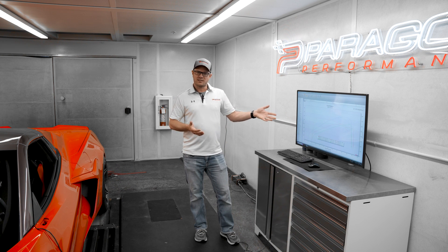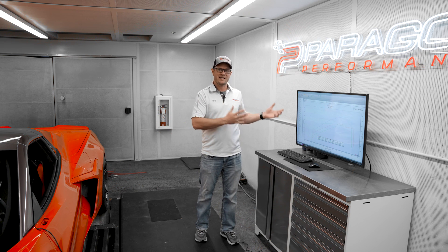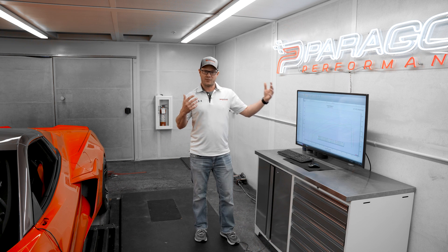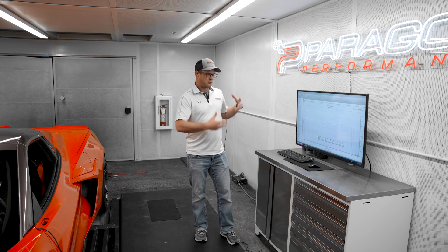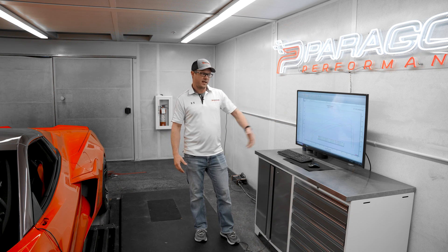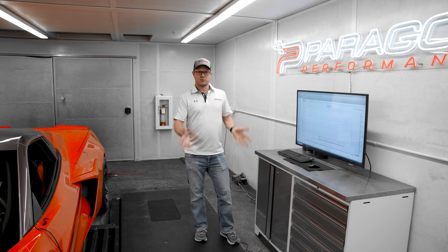Some shops like to use SAE. A primary reason for using SAE is that a lot of racing entities require SAE numbers. Anytime someone comes and uses our dyno and needs NASA qualification numbers, we switch the dyno to SAE and run it that way to produce those numbers. Dyno correction is always needed — you shouldn't run uncorrected numbers because you're not really getting a true comparable number that you can look at from dyno to dyno. Correction is always going to be in place. Standard is going to be a little bit higher, SAE a little bit lower, but that's what the numbers mean.